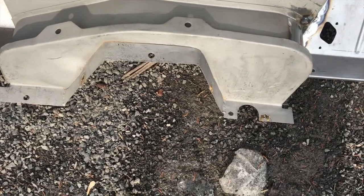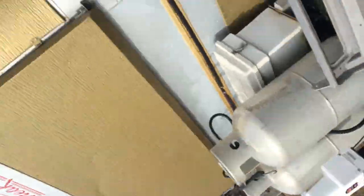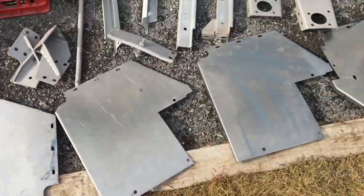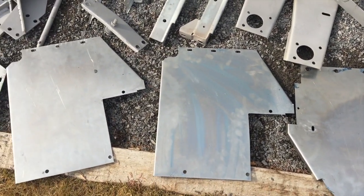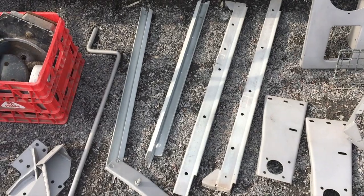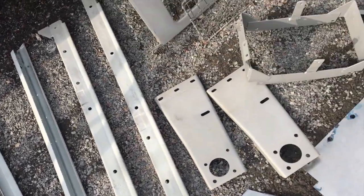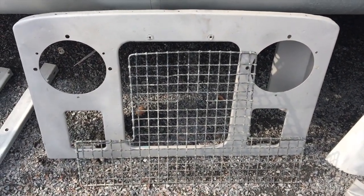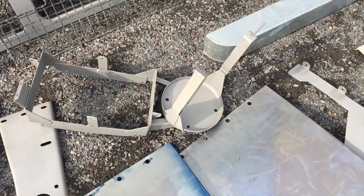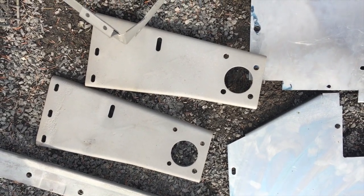These pieces covering the front of the bell housing are sandblasted — that was actually an NOS piece we found. The rest of these pieces were all sandblasted: the capstan plate on the front, two sets of steel splash guards — they don't last very long, they're inside the front fenders. Those square brackets are engine mounts. You can see a couple of cappings for the doors, and those pieces underneath the doors. We have a grille panel and the grille — all sandblasted, in excellent shape, didn't need any welding. This is the battery box and the air cleaner. Those rectangular pieces are the brackets for holding the bulkhead up and the steering box.